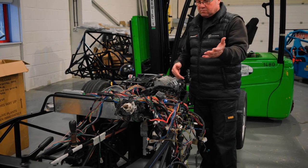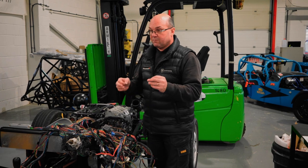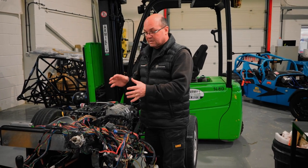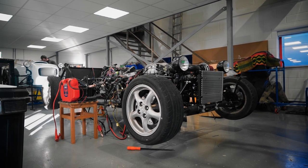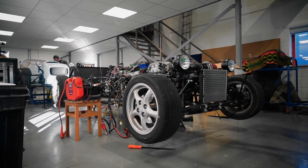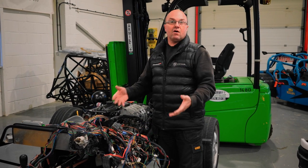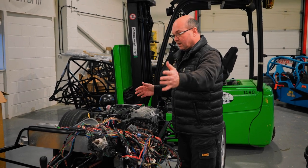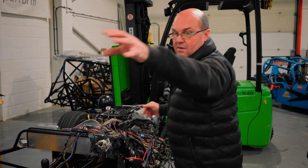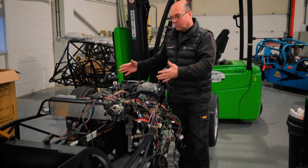It is all in the manual for the guys that are building them. And if you've got any queries on that, or if there's something not quite right, or you're not sure, then fire us an email rather than phoning, because it's quicker and easier to resolve. But the Mazda loom is good. It's just very long because it's sitting in a bigger car and it runs front to back. The battery's normally here on a Mazda, and we move it right up the front, so we have to change and shorten quite a few leads.